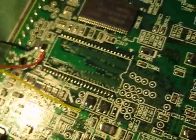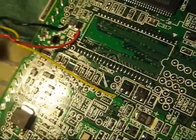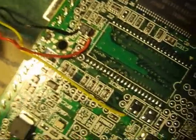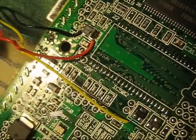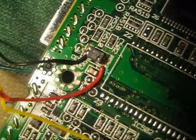One quick thing — I think this wire came off when I put it back together the first time, which was a bit of a bummer. I was listening to it and it wouldn't boot my imports. It checks the table of contents, makes the little beeps and squeaks that the laser normally makes, but it won't actually boot the game. So if you come across that problem, just check all your solder joints again. It'll sound like it's loading the game perfectly, then it'll pop up saying you don't have a disc in there. Check that power — that's a plus and a minus power. Obviously you want to wrap these in electrical tape and tape them somewhere in there, because you don't want them flopping around.